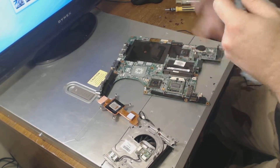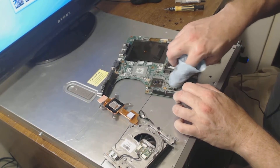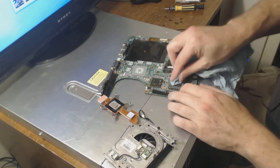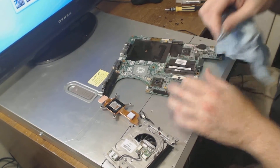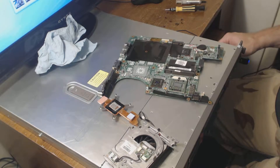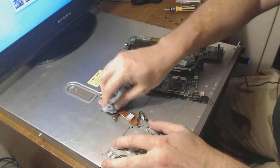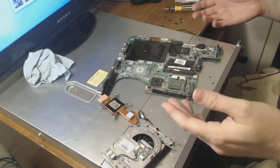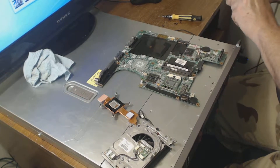This stuff isn't conductive anyway, but it just looks neater if you don't have it smeared all over the processor. The DV6000s — we see a lot of them at work. Either the cooling system is poorly designed, or the AMDs just run way harder than the Intel chipsets and they don't handle it too well. Then you have people leaving these on their beds, on carpet, or on their couches — not a good mix.